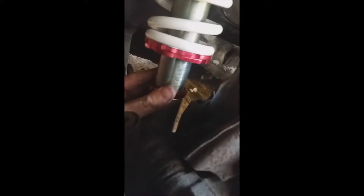After a bunch of fighting with it and a nice trip to the store for some hardware and some other unexpected issues, we got the rear in. This is the passenger side — you can see it's in. This is where you adjust the preload, and that's where you adjust the ride height. We have it set to pretty much maxed out, which is still shorter than the stock shocks. There are two bolts at the top — I think they were 14s — and one bolt down here. This one was a bitch because mine snapped, so we had to replace it. There's another bolt for the lower control arm you have to disconnect so you can get the whole shock assembly out. Everything was not that hard except for the good old Long Island rust.